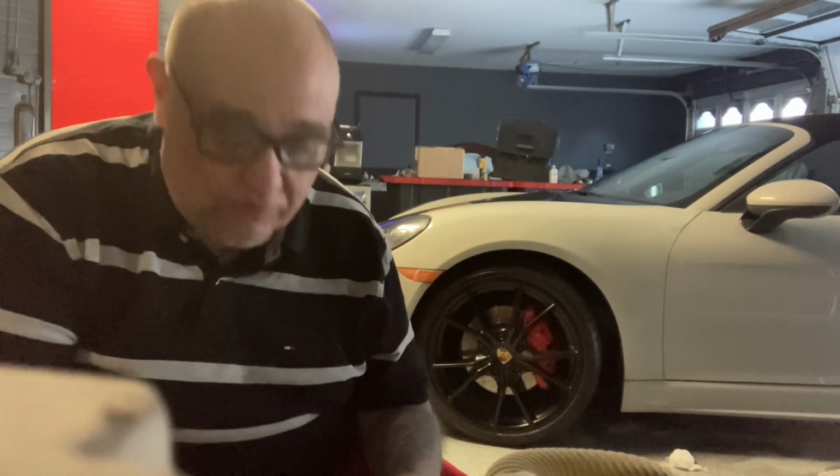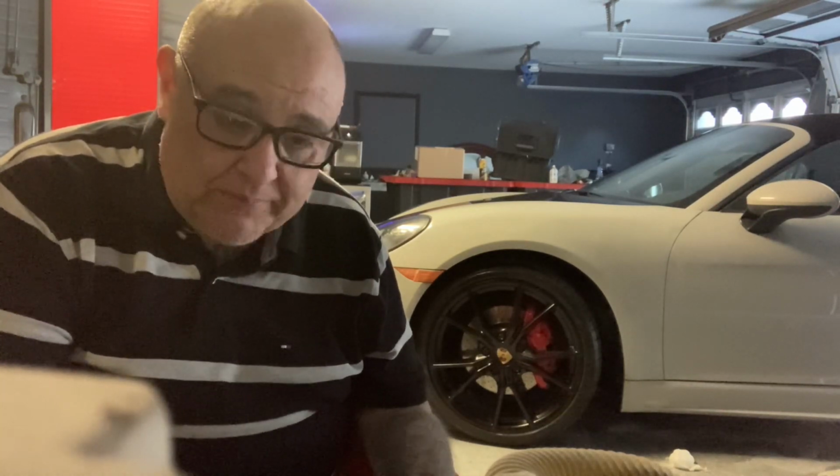If you're watching this video, you most likely have a Porsche Boxster or 911 convertible, and you have a broken convertible top switch. So today I'm going to show you how the switch actually works and give you a temporary fix if you can't open or close your top, and then show you how to replace the entire console switch box, because you can't just buy the convertible top switch. You have to switch out the entire box.